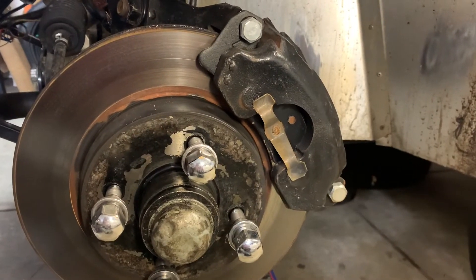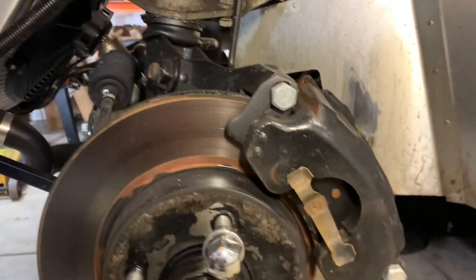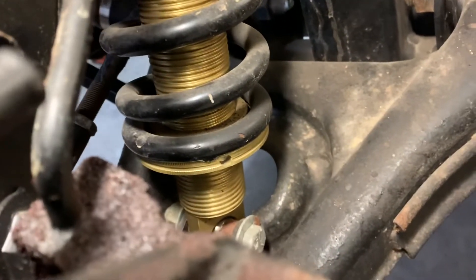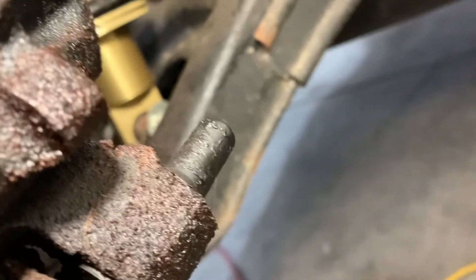For a little bonus content, I went ahead and got the front wheels off to add this to the video. You can see right here things are wet on this caliper — it looks like it's leaking. There's a lot of moisture where the hose fitting goes in, so I'm guessing that's leaking there and it's come around the back and run down the back of the caliper. Everything's pretty wet in there.